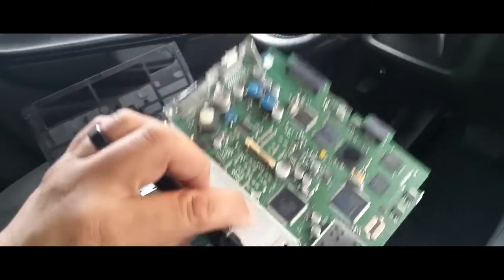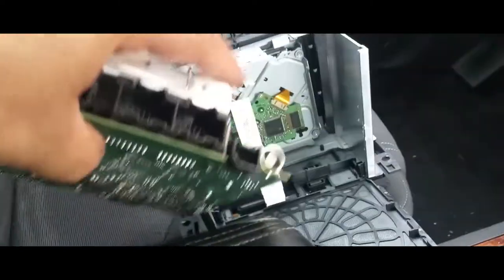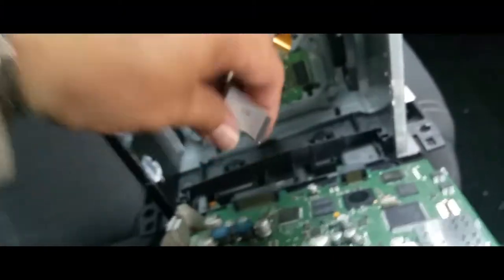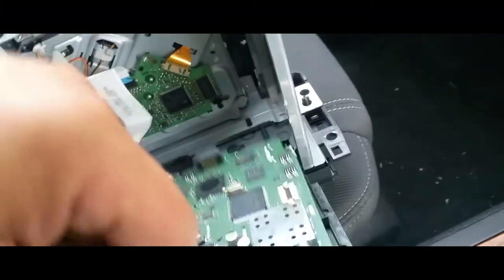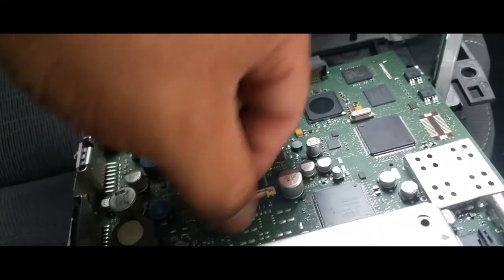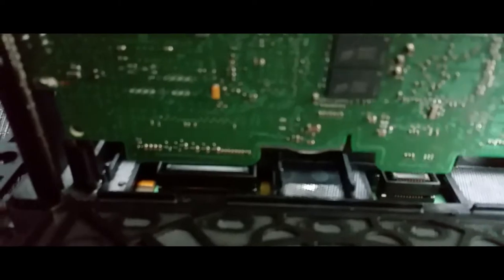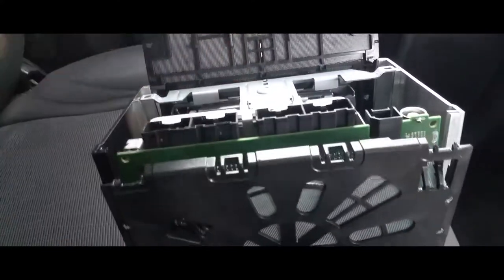These are the chips that you need to swap out. This is the one that came from LKQ. The one that was originally here is in this one now. All you have to do is remove this chip, install the original one, put the ribbon back on, lift this up and put the ribbon back in there. Once you have the ribbon back in there, set the chip in its place inside these two little plastic tabs just like so, and it slides right into place.